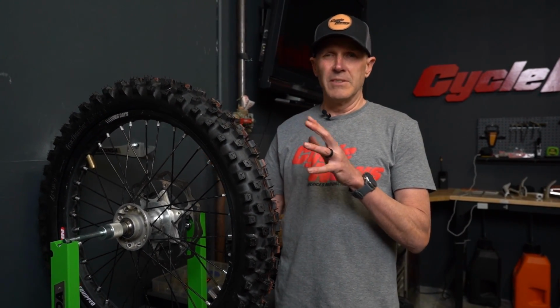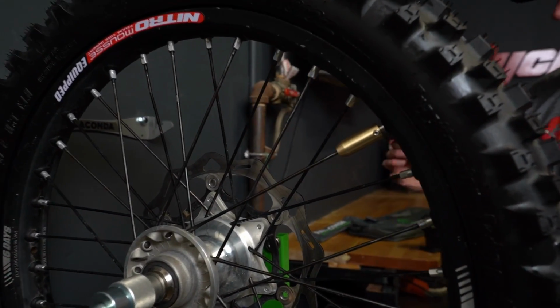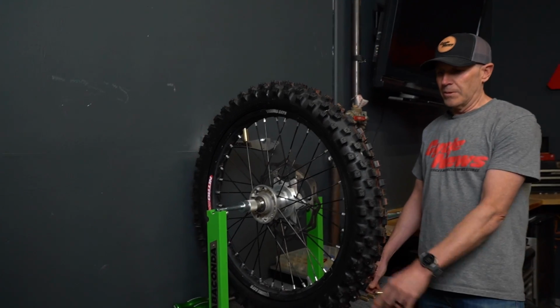Now even without a rim lock and everything, the tire's going to have a little bit of variances, and the wheels and all that stuff can have some variances. So there's some benefit even with an ADV bike that does not have the rim lock in it. That's why pretty much every street bike tire gets balanced. You can see here, it's going to swing back and forth.